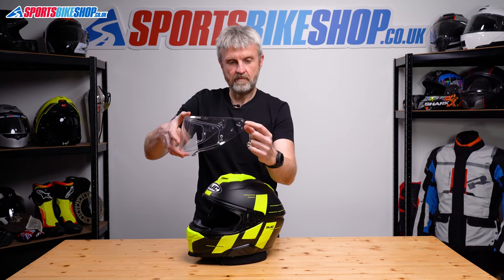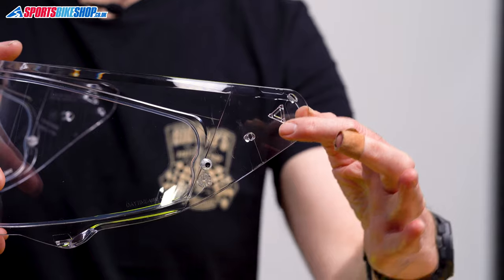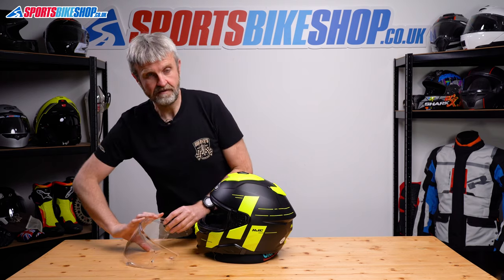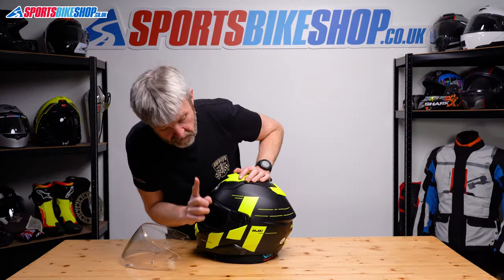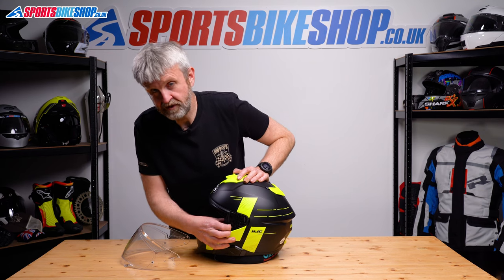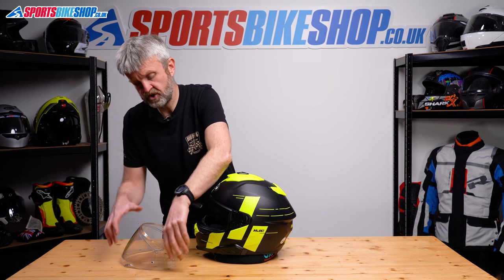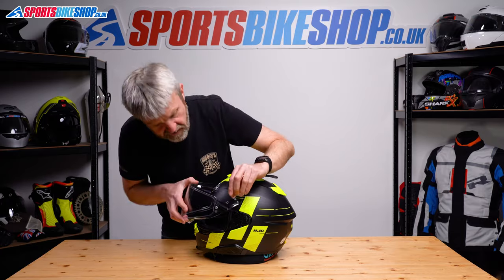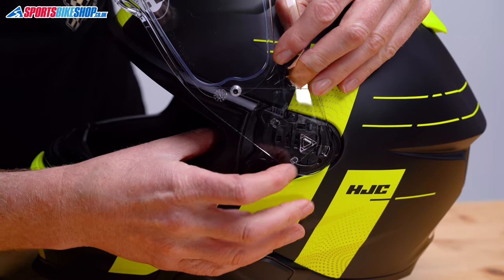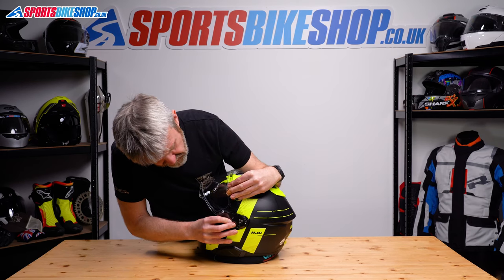For refitting, there's a triangle in the middle of these three tabs. The side of the triangle pointing towards the bottom of the visor — we're going to line that surface up with the front edge of the housing. First, make sure the lever is locked forward, as it should have been when you pulled it forward to release the visor. Check beforehand, because it will make it really difficult — if not impossible — to put the visor on if it's gone back to its original position. Get that bottom edge, line it up, then apply some pressure to push it home until it clicks.